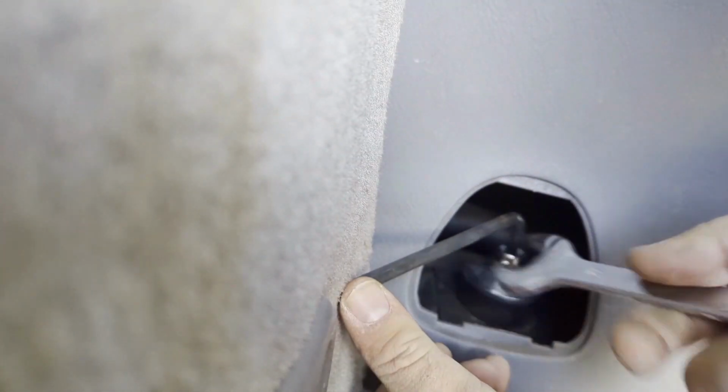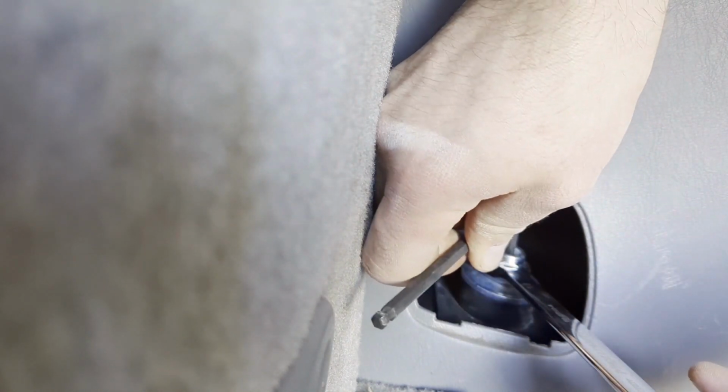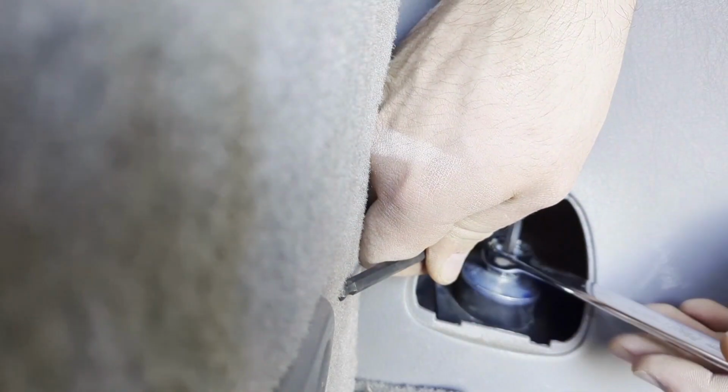This is a very tedious job, so if you do have a ratcheting wrench, definitely use it. There you go, that makes it easier. They say 22 foot-pounds online for this one, but I don't know. I would tighten it up until I see the rubbers are somewhat well squeezed and the locking ring on the nut is well on the thread. And I'll probably leave it at that because it's going down quite a ways before it starts tightening up, so I wouldn't be too concerned.